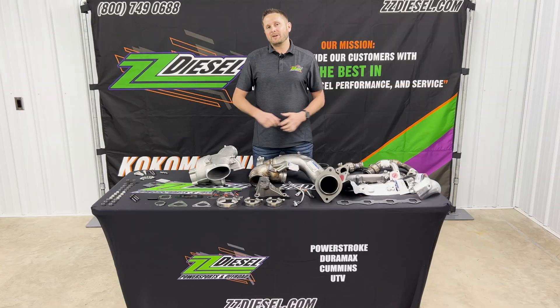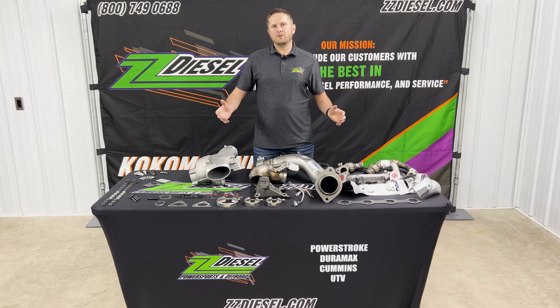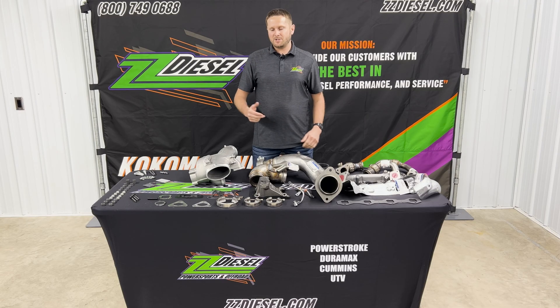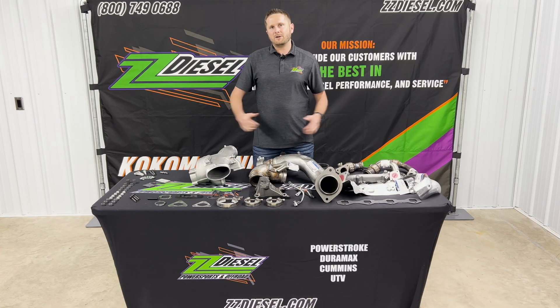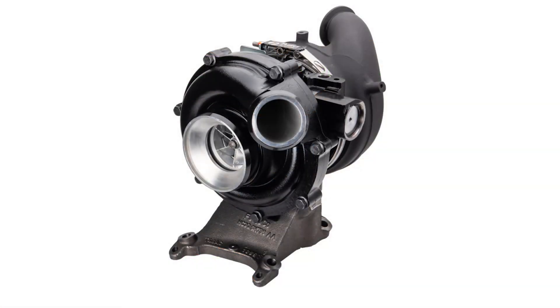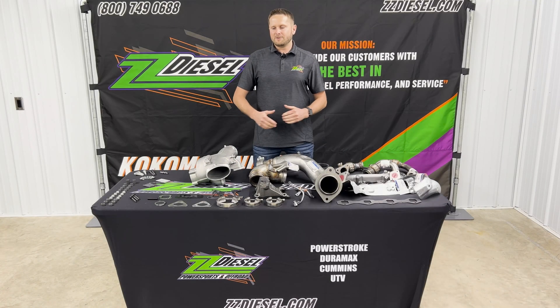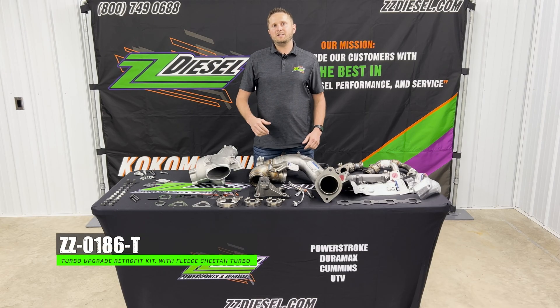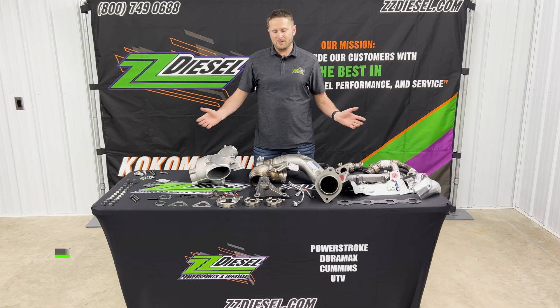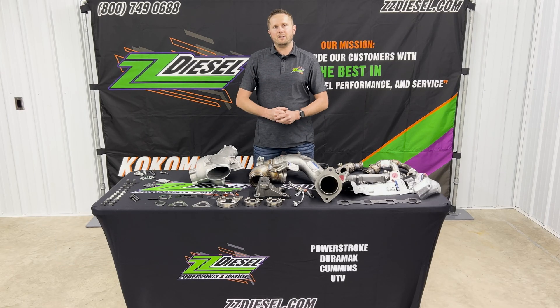Just some things to keep an eye on when you guys upgrade this — it's a completely different style turbo. One cool thing to note: we've always teamed up with Fleece Performance Engineering, they make great products. They offer a 17 to 19 Cheetah Turbo — you guys have all heard of the Cheetah Turbos. We're going to pair this kit with a Fleece Cheetah Turbo, so you guys get the best drop-in upgraded turbo that exists today with a billet wheel. You're going to notice some performance differences — while driving it's going to spool quicker, and you guys are going to be really happy with that. That part number is ZZ-0186-T for turbo, and that's going to pair this entire kit with the Fleece Cheetah.